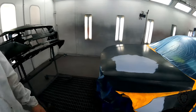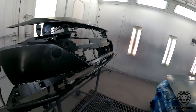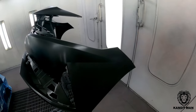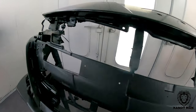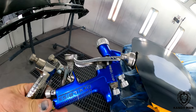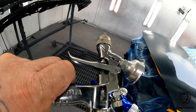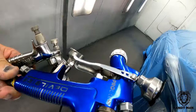We're going to seal, go through the base and clear on it. This is just a hood, fender, and a raw bumper. Also tip: make sure you guys are getting paid for the raw prep on these bumpers — that's a tip that'll get you more hours and a better paycheck. We've already adhesion promoted the bumper and we're going to seal it with this Pro Light S 1.0. I'll also tell you what I use the LPH 80 for — that one is a 0.8.